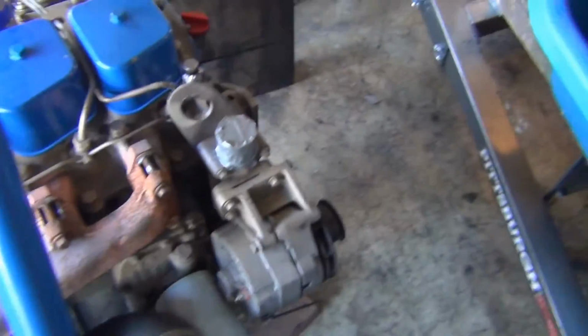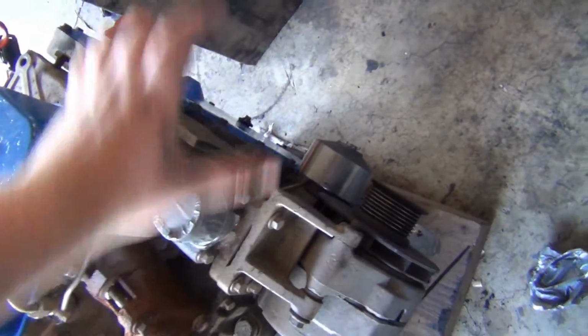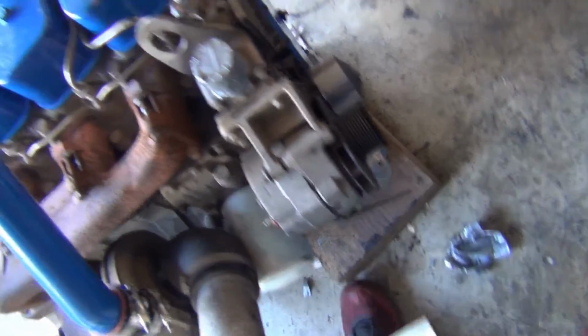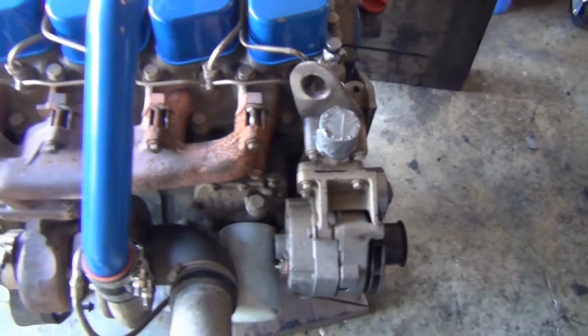And then we'll be able to use the radiator hoses that come with the Dodge Ram. They should go right on here. I wonder. Yeah, I don't think you can switch that around. I've seen some of these have it where the neck comes out this way, but I think what I saw from the Dodge hose is that it comes this way and then curves right down into here. And this is pretty normal too. So yeah, I'll be able to use Dodge radiator, Dodge hoses. That way it's more of a common hose, and if it pops, we can get one from an auto parts store and not have to jimmy rig something. So it'll be a nice, reliable setup.